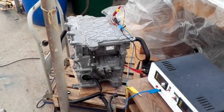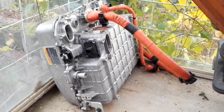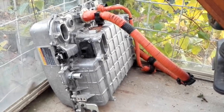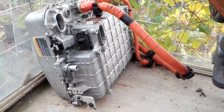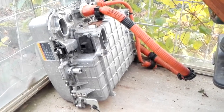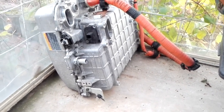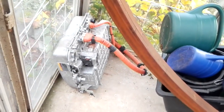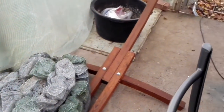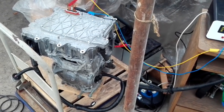This is a pretty compact unit. What we have here is the charger, and I'm pretty sure it will fit into the engine bay, but I would rather put some more batteries in the engine bay instead of this big charger. So I'm considering maybe trying the inverter charger concept, but I'm not sure if it will hurt the magnets if there's DC in the motor coils. Or I'll just go for DC charging and carry a small DC charger with me whenever I go on trips. Actually on German motorways there are quite a lot of CHAdeMO chargers, so I have a good chance of using those on longer trips.